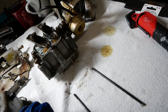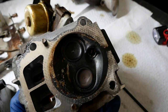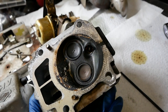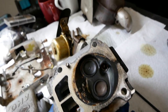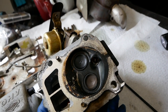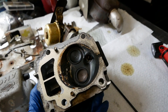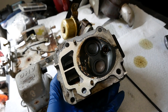There's been a lot of oil in this cylinder. It ran, and I think the valve assembly is going to be fine. It's a shame the pull cord was off this thing, because just by pulling the cord lightly and feeling for compression, I would have felt that there was no compression at all. I definitely would not have bought it for what I paid. I would have talked the guy down. But there wasn't a pull cord in it — couldn't check for compression. I took the risk. You live and you learn.